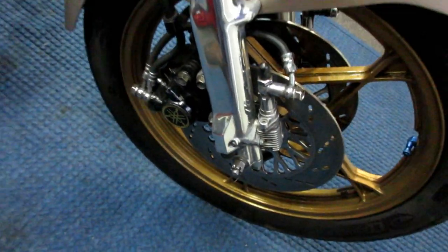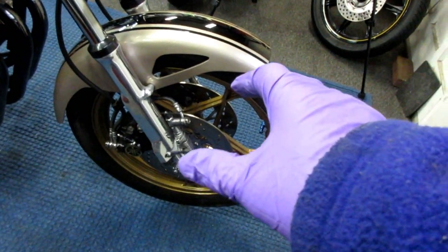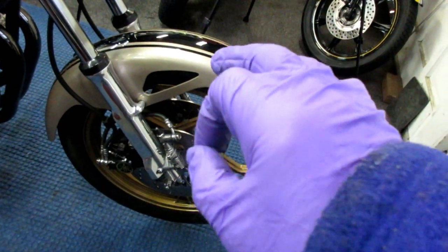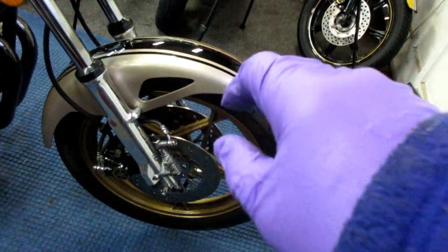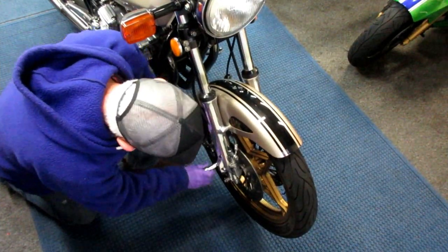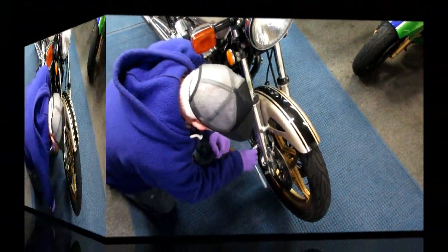So with the front wheel off the ground here, the first step is I wanna get the calipers out. I want to get them up on zip ties, and the whole objective here is I want to get the discs off the wheel today, no matter what, so I can take them downstairs and do that little rejuvenation and repolish on them. And if I see the day is running late or Karen changes the plan, I'll put the wheel back on without the discs, just so I can move the bike around in the garage. And boy, that rain is coming down basically the whole day, so we're not losing a riding day, or you're definitely not losing any day. We could be outside doing anything.